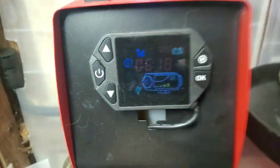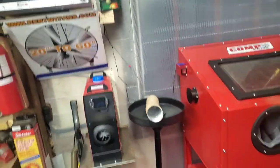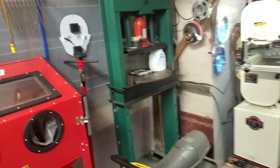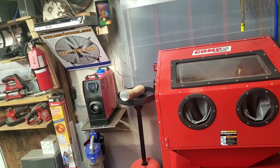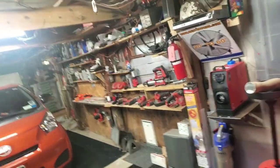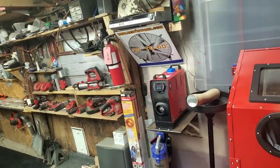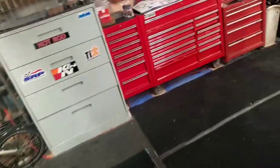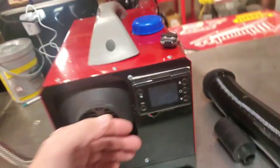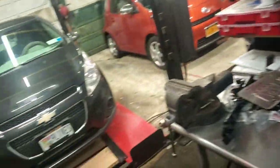This is kicking off some nice warm air now. Once it gets up to the double red bars it's running wide open. These heat up places pretty quick. If you have a well-insulated camper, don't get a huge one — it'll just run at low speed all the time and start clogging up on you. Also, one of the negatives on these is the power wire is too small on some units. So this one basically just shut off because the power supply was too weak.